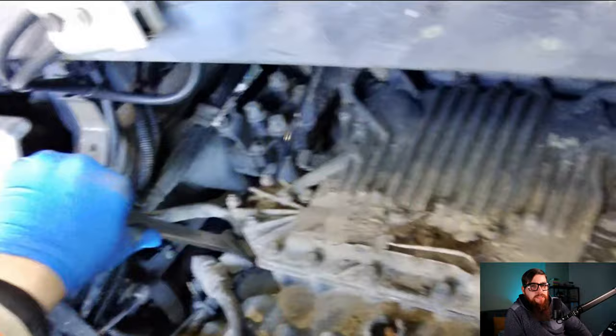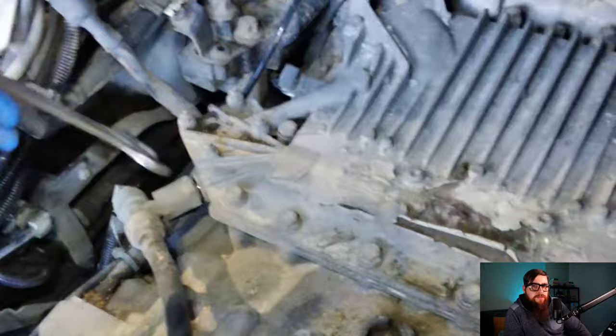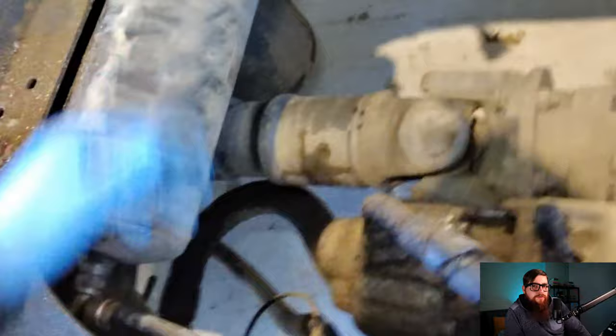We can crack this pipe off with a 24mm spanner. This pipe feeds the clutch actuator under the gearbox and supplies the gearbox air pressure regulator with air from tank 4, which is situated here. Best to drain this from here rather than pulling the pipe off with 10 bar of pressure behind it.